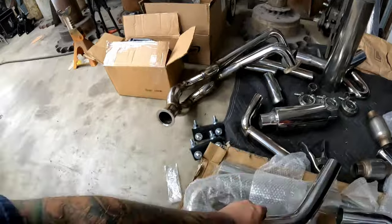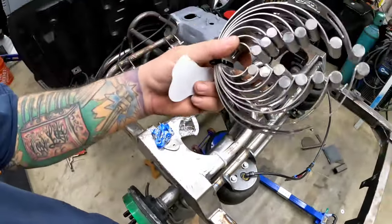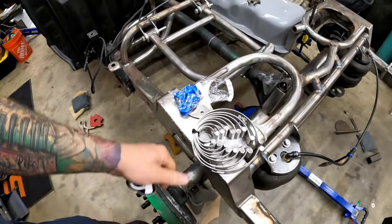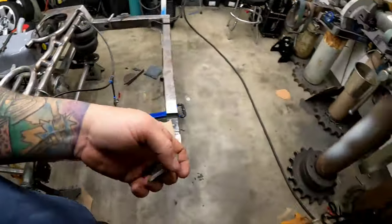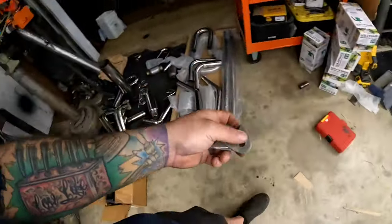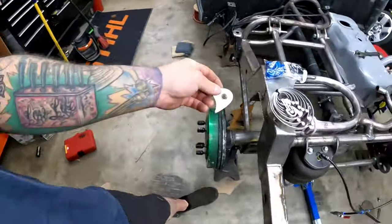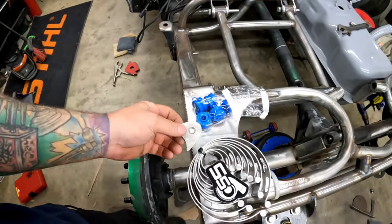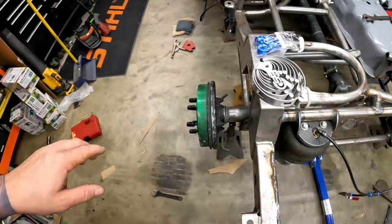Like I said, we got this bellow. I got these tech clamps all the way from Australia. I'll be showing how these are used, even though I've never used them before. Last week we made about four stainless steel tabs that will be welded onto the exhaust. I was able to find the high-temperature silicone bushings that go inside of these, so we're going to be learning how to use those as exhaust mounts.